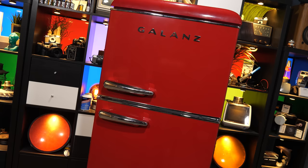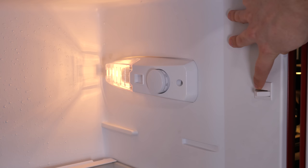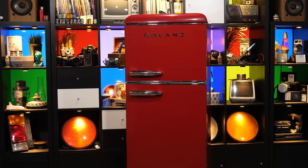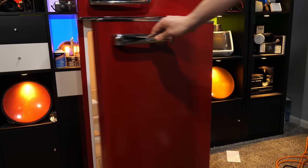It's decided to reject modernity and embrace tradition, and not just in its retro styling. You'll find absolutely none of that modern complexity here. In fact, there are only four components to this fridge, half of which are the door switch and the 10-watt incandescent light bulb. As far as what makes it refrigerate, there's a mechanical thermostat which controls whether the compressor runs or not, the compressor itself, and that's it! There's no fans, no sensors, no defrost heaters or timers, no Wi-Fi or Bluetooth — it's just a single refrigeration circuit and a thermostat, and that's it! I love it!